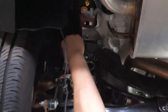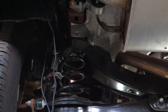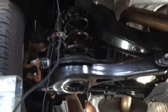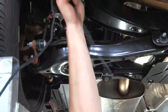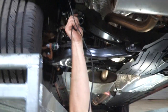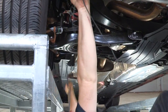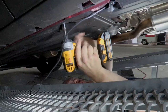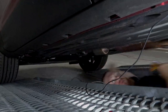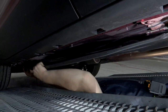We've got our power wire ran outside the car, and we're going to run that up to the battery. We just want to stay away from anything hot and moving parts. Use zip ties if you have them. If you can pull a plastic panel down, run the wire underneath it and put it back. Make sure there's no sag underneath so it can't catch on anything. We're going to drop a few panels here to run the wire across the top and then put it all back.